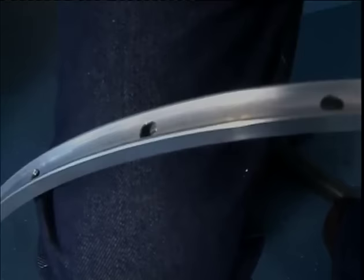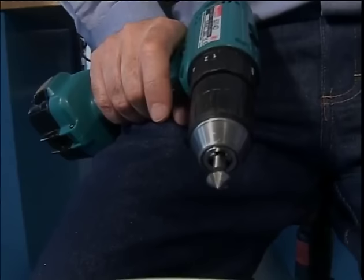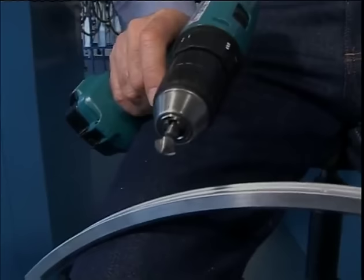On tubular rims, the valve holes are usually drilled too small in the rim bed. As a result, the tubular does not lie flat in the valve hole, which means that with every turn of the wheel, the tire bounces uncomfortably. We solve this problem by countersinking the valve hole. The tool we use is a 90-degree deburring tool, 13.4 millimeters diameter, and the cordless drill.